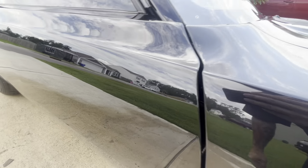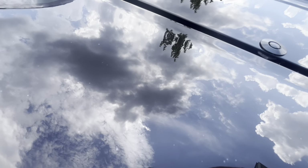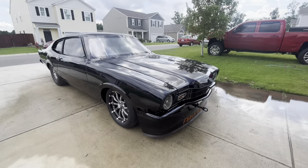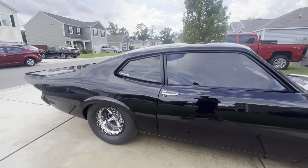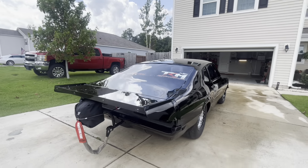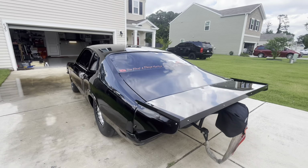It really is not on any of the sides. It's honestly just right here on the top of the fender, from when I was grinding it at that time. Just the little tiny speckles that are all on it from the hot sparks sitting on top of it. So maybe one day we'll wet sand and buff that out. I'm gonna put a coat of wax on it by hand probably tomorrow. It's supposed to rain here, so I'm gonna coat it with wax. That'd be the first time that it's been coated by hand with wax while it's out. And then maybe at some point we'll come with some 2500 or some 3000 and buff out that fender.